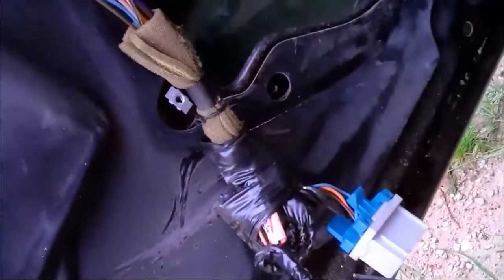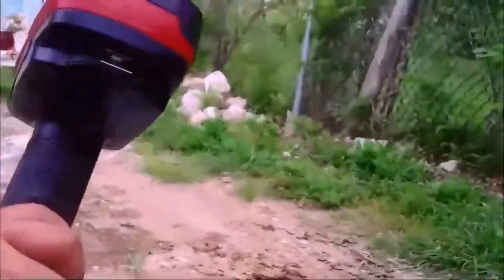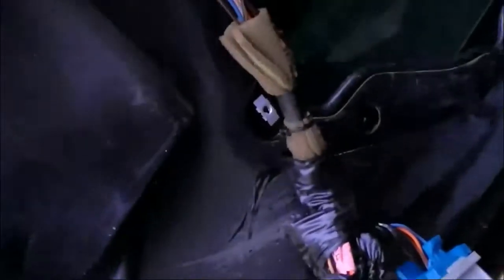I took the speaker out to check if the tweeter that was already on there still worked. To take the speaker clip off, it's similar to the window controller — it's got a white retainer clip. You use a small screwdriver to get that off. The speaker itself was held on by three screws on the side, and they are 9/32 inch.